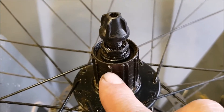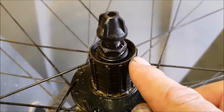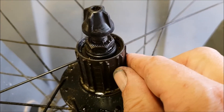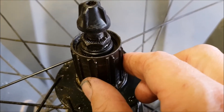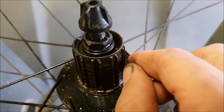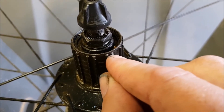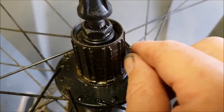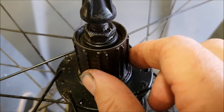Take a look at this — I think this shouldn't be like this. I think all this is damage to the top where that top cog has become loose and slipped round, so I think that's at least part of the problem. There's not enough there for it to grip onto anymore, so I suspect we probably need a new freewheel, really.